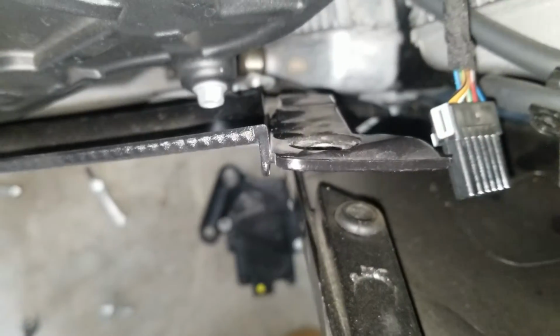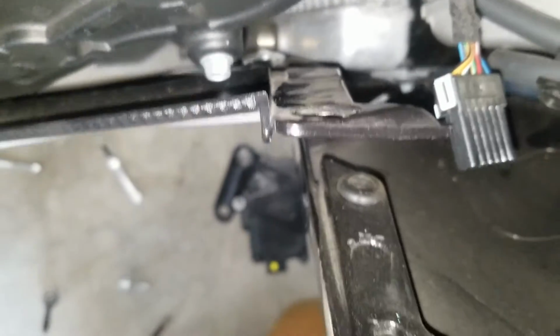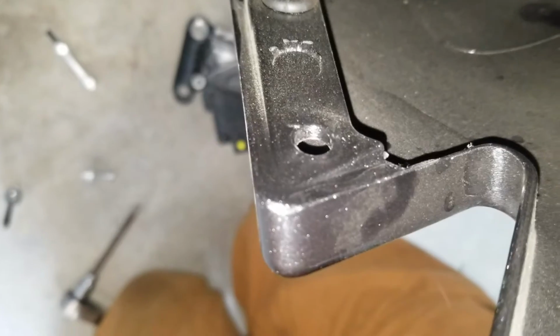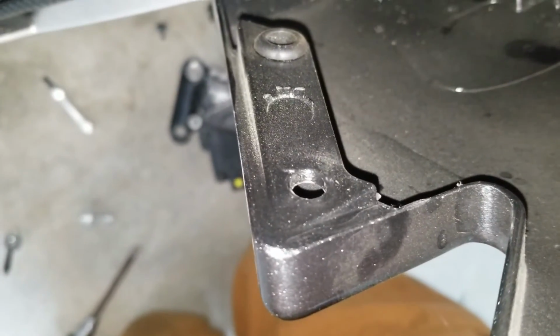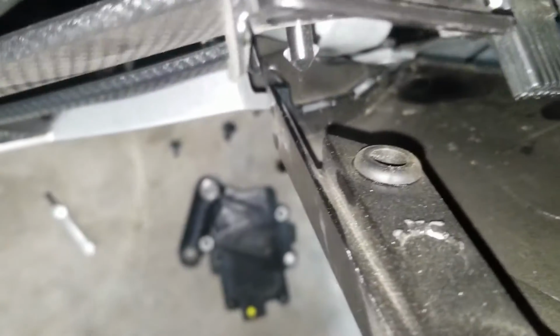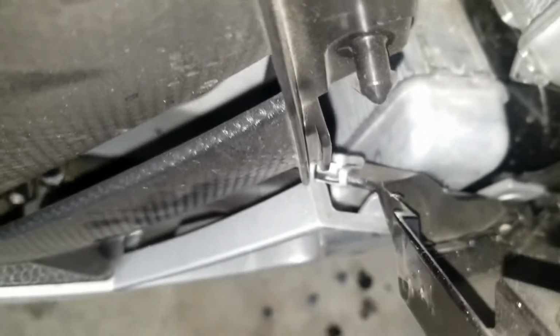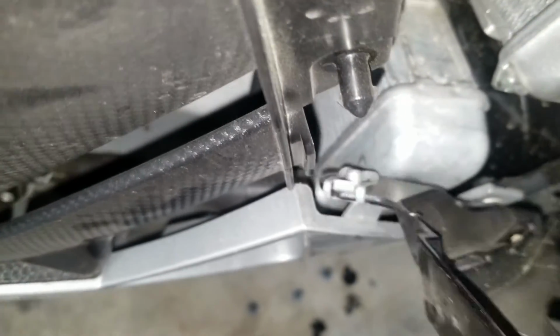It's going to be connecting through that hole that's right on the carbon fiber looking piece at the top of it, and it's going to mate into that hole right there on the side fairing. There's a little rubber grommet there that this pin resides in, and then as you can see, that hidden bolt down there clips in through the backside.